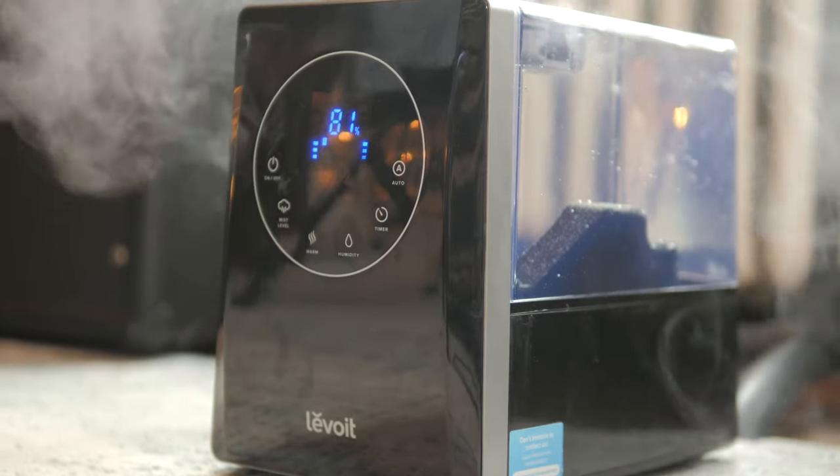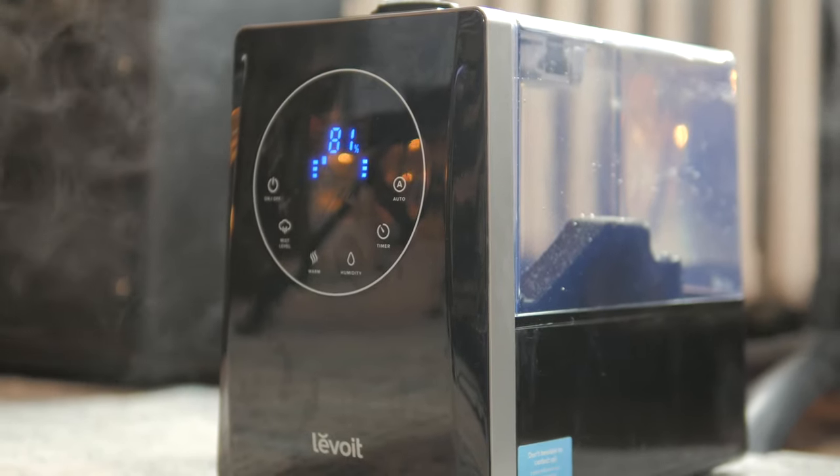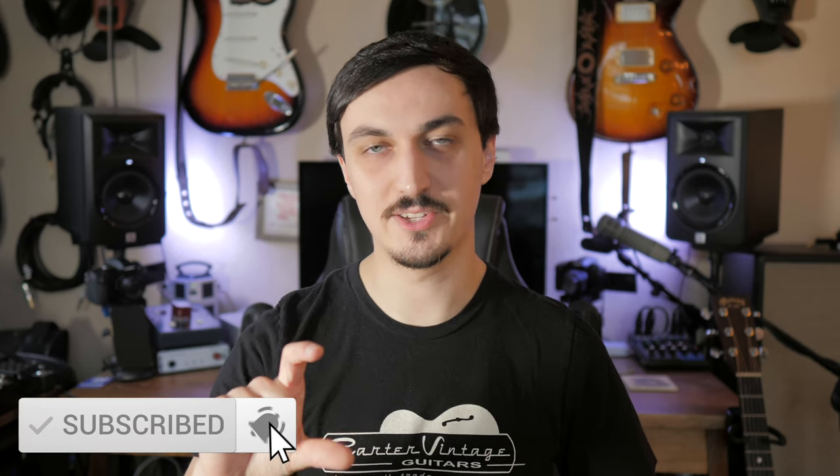That Levoit humidifier works great — I've been using it for the last few years and there will be a link in the description with a small commission if you purchase through it, which helps fund the channel. The one thing I'd say is if you get a room humidifier like that, you have to remember to descale it every now and then if you're using tap water. Any water with a little calcium in it will build up, so you make an acidic solution — white vinegar and water, about 50/50 — fill up the tank halfway and run that through it. I do this in the garage on a warm day, usually once during winter and once at the end of the season around March before I put it away.